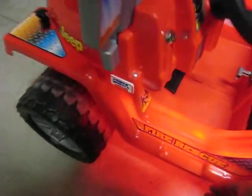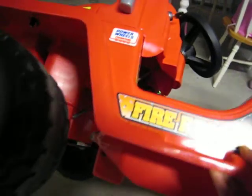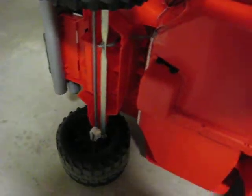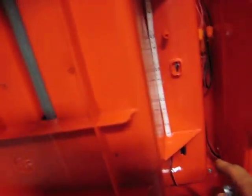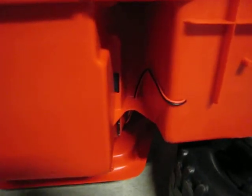With some of the lights turned back on, we'll go ahead and turn those lights off and lift up the vehicle to give you a view of the underglow lighting. You can see here one of the strip LEDs for the underglow lighting, and the wiring for the taillights. Just drilled some small holes in the body panel to bring those wires in, and drilled some small holes in the webbing there. The strip lights are actually red micro-LEDs, not white in color. Put some up there in the wheel wells, but you can see how nicely they light up the vehicle.